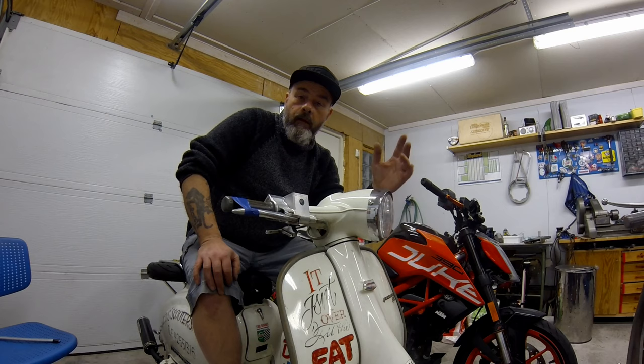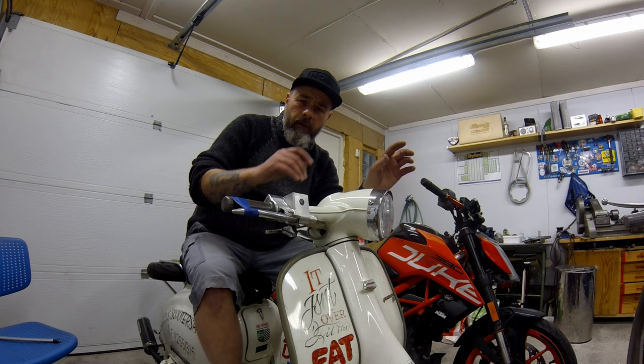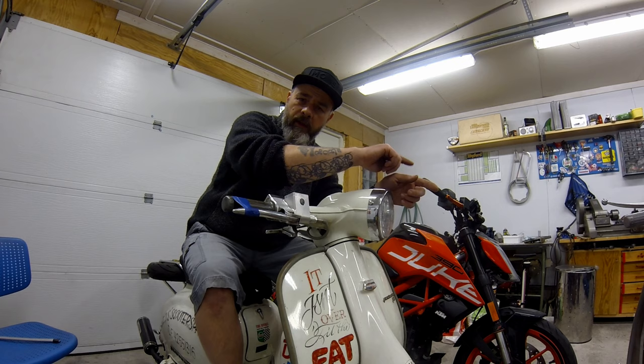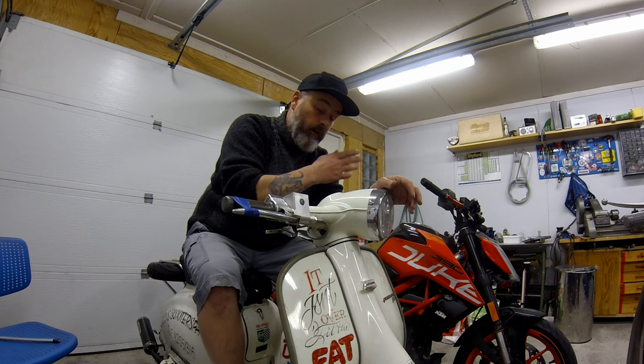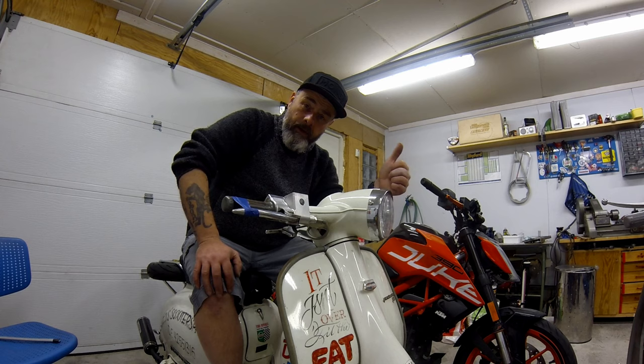That's basically the easiest way you can bleed your brakes. Now if you buy a brand new brake system and you're just going to fill the oil, you do it in exactly the same way. The only difficulty I've had was about 10 years ago I had a double disc — you do one caliper, close that off, then do the same with the other caliper, but I had problems with a bubble accumulating in the U-bend of the hose, so I had to go to a motorbike garage where they used a vacuum system. But normally on all the other bikes it's really, really simple. If you think these tips were helpful, subscribe, give me a thumbs up, and I'll see you in the next video. Take care.